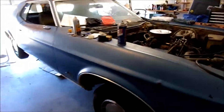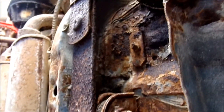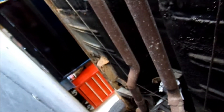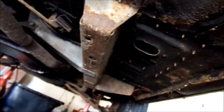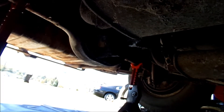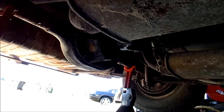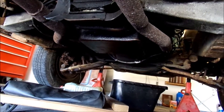Anyway, that's my update on what I've been doing. I'll get you a shot of the underside — we've got some rust here and there. Really bad there, but it had undercoating at one time. The exhausts are still in good shape. I've got the drive shaft out, but I think we're not even going to have an exhaust leak. All the unibody seems to be in good condition, so this car is going to run and drive. I'll probably dismantle the back side of the differential and scrape all the old gear oil out and put fresh gear oil in it. I'm going to disconnect the gas tank before I start it and let it drain, and I'm not going to run through that fuel pump.